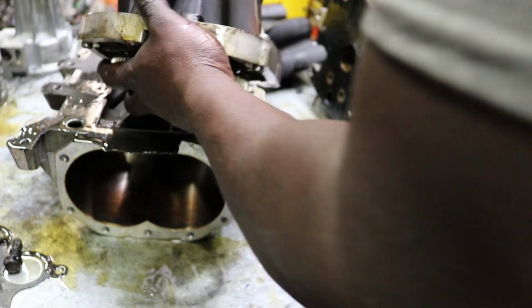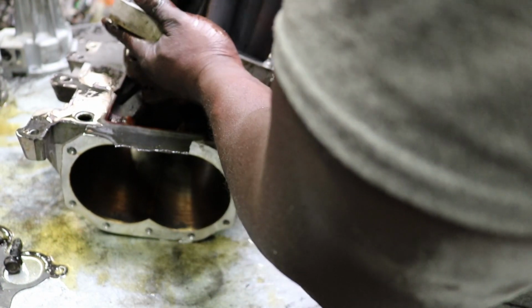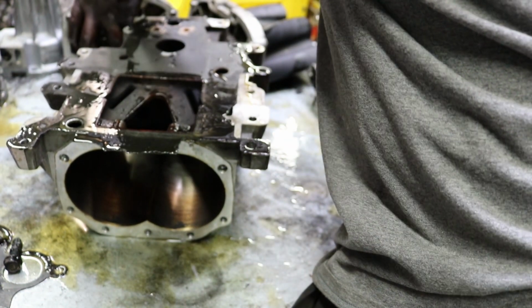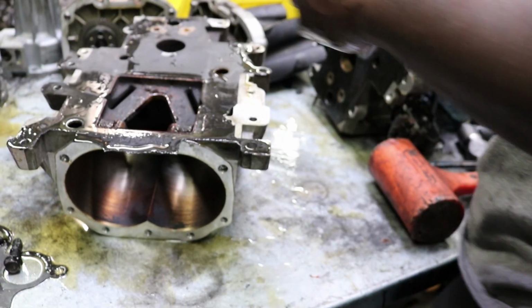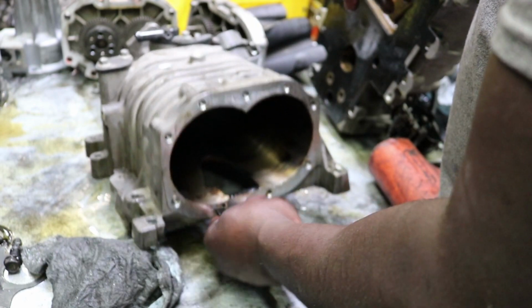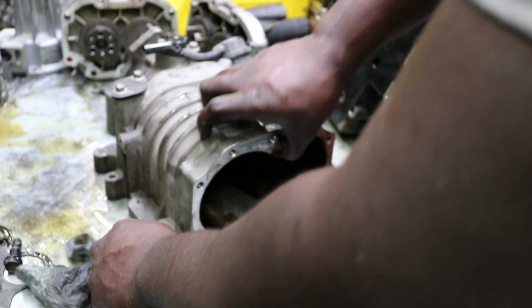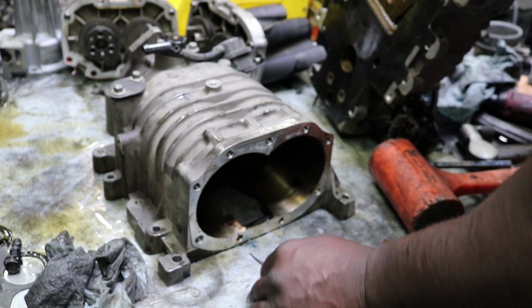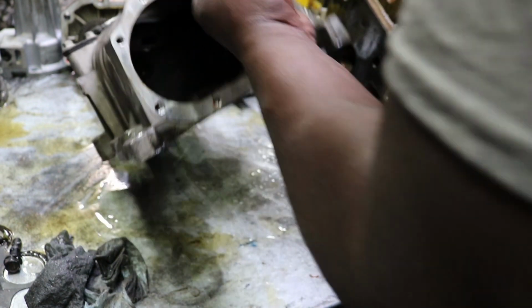All right. And thank God, these blades look pretty good too. Cool. All right, so no chips, no damage on those blades. Let's see what the inside looks like here. Same thing, it's just scrapey. Same deal. So I'm just assuming that's one of the natures of this supercharger at this point, because they're both scrapey on the inside. Scrapey meaning that the superchargers have expanded at some point and hit the walls. This one's definitely worse than the other one.